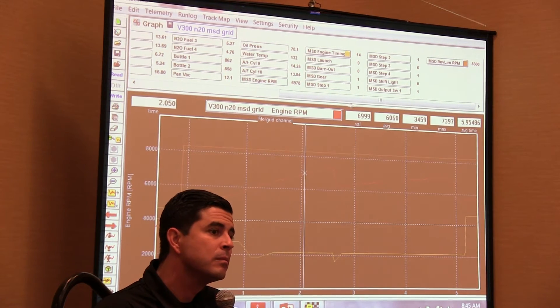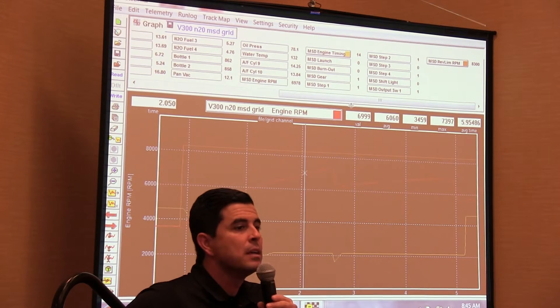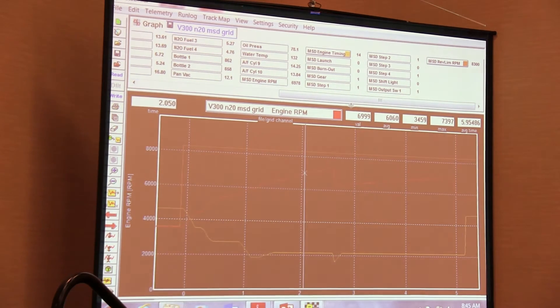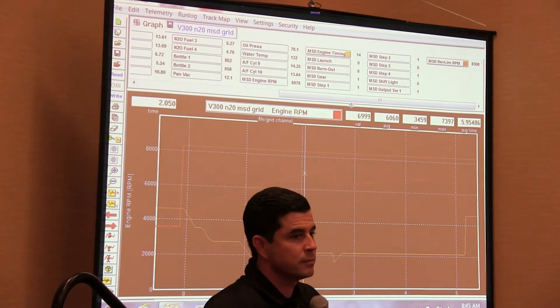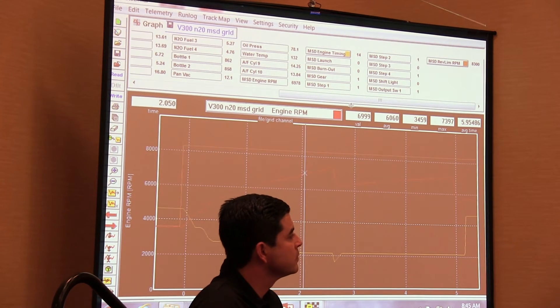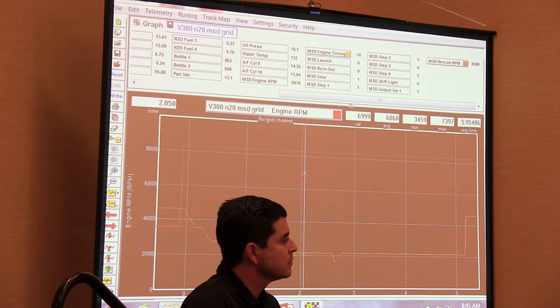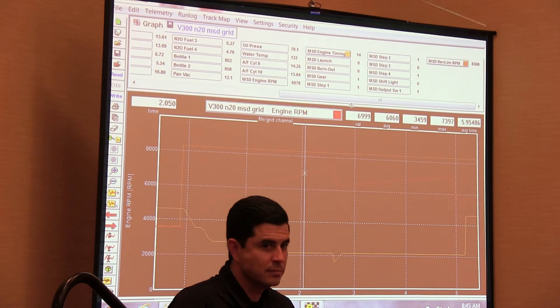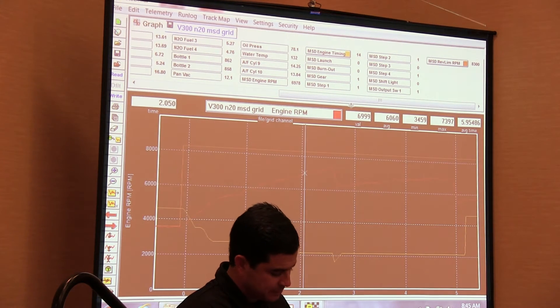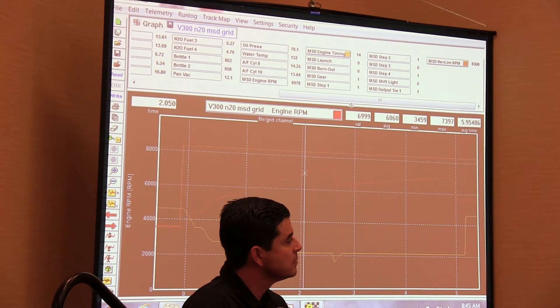What would I need so that I can show that? There are two pieces of the Power Grid you can get — basically the brain unit — and that would go to your 6AL. They also have the ignition with the coil and everything. The Power Grid has its own box, it's two pieces. But if you already have an MSD box, you can get the Grid brain and adapt it to the MSD box you already have — whether it's a 6AL, a 7AL2, or even the 8 series. You can take that brain unit and put it on any of those, including a Digital 7 that's already programmable.